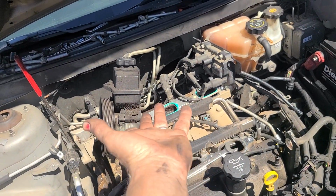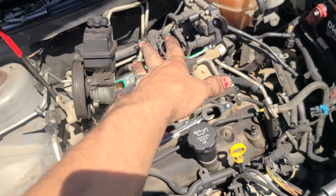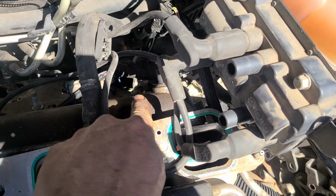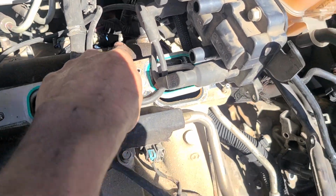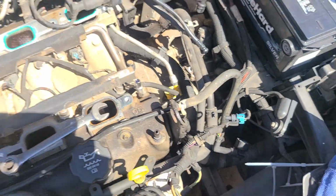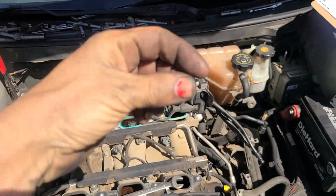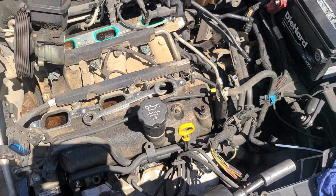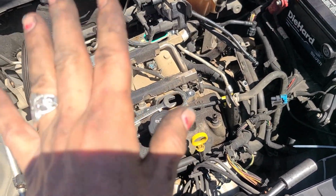And your valve cover comes off pretty easy. Just 4 8mm bolt holes. Normally you take off that 1 stud on these if you can get it out. It makes it a little bit easier, but I was able to snake in there and get the 8mm bolt out of the valve cover without taking that out, and it cleared just fine. Some people's other applications may be different.